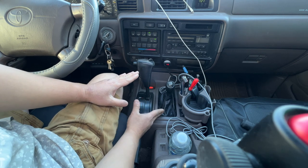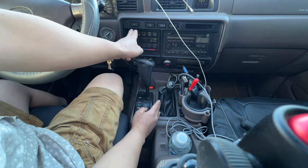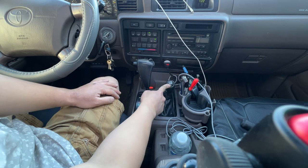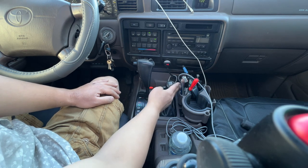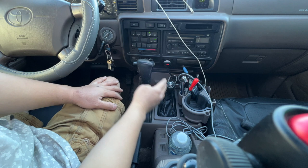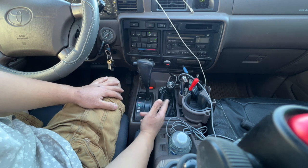On a normal automatic one, if you haven't done the 7-pin mod, what will happen is that your center diff lock will activate only when you're in low gear. So right now we're in high gear. You have high, neutral, and low — this is your T-case right here. Center diff lock is where it locks the transmission so that the front and the rear driveline both get equal power.